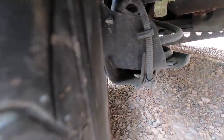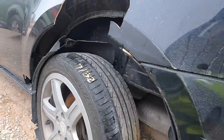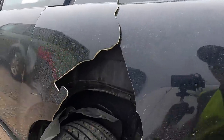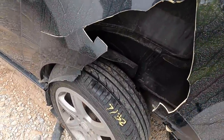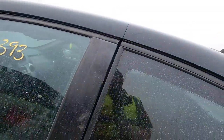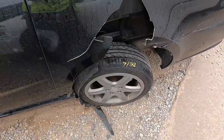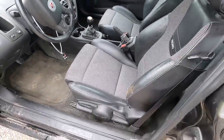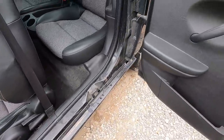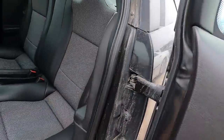It's not a big deal — I've done these before. It's got replaced Excel shocks on the rear. The car is probably totaled because Saturns just aren't worth anything these days — they haven't made them in a long time and you can't get new parts, you have to go junkyard. But it's fixable. It's a small, fairly lightweight rear axle. As you can see here, the quarter panel just bolts right off the car.